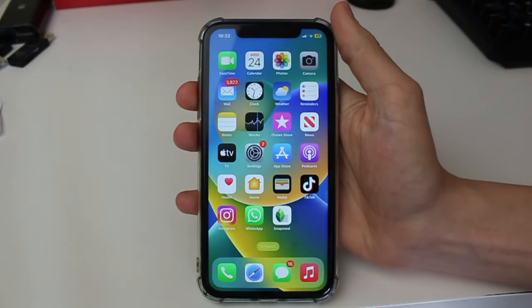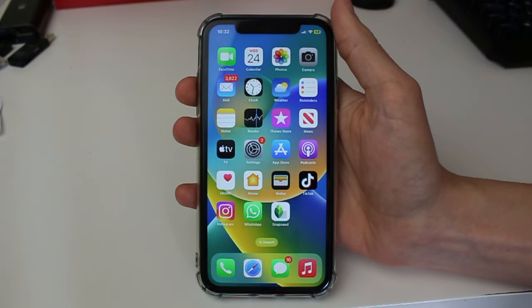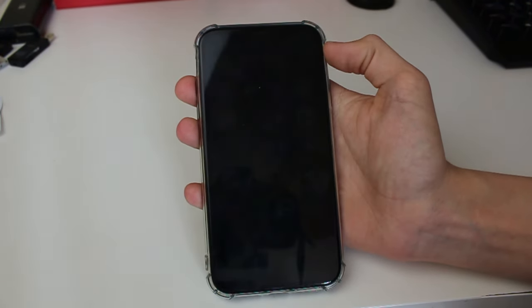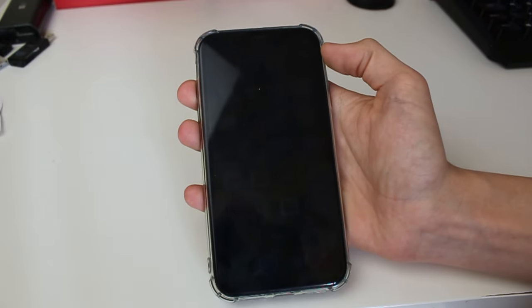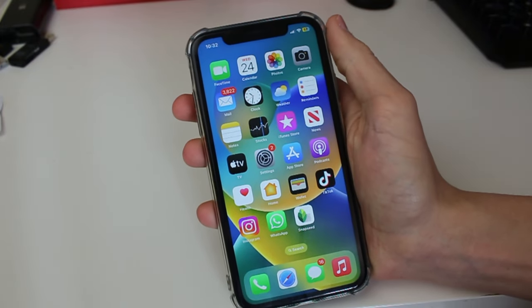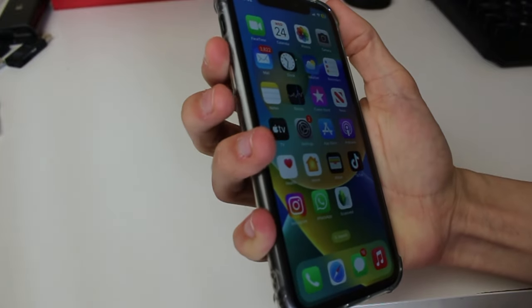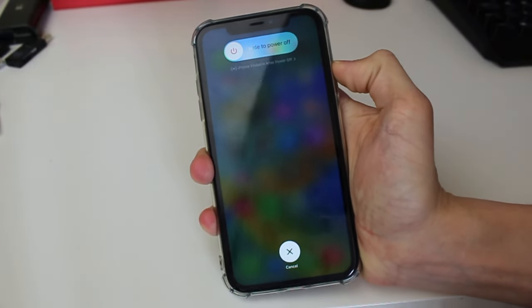The first thing you want to do is fully restart your iPhone, because this could just be a software glitch and restarting it should fix it. We can perform a forced restart. On iPhones which are iPhone 8 or above — iPhone 10, 11, 12, 13, 14, etc. — all you need to do is press the volume up button, then the volume down button, and then hold the power button until you see the Apple logo. It needs to be done quite consecutively, just like this, and you should see the power screen.